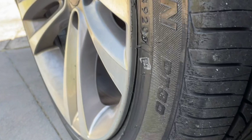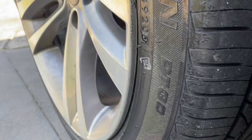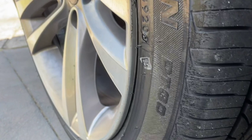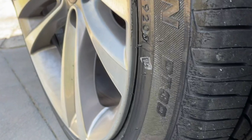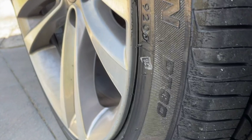Obviously I was very disappointed at these tyres. This was the day they were fitted — when I came and had a look at them, they were just so much smaller. The numbers on the tyres said exactly the same thing, but they were clearly smaller — less rubber on the road and less protection over the rim. I have really found Chinese tyres to be better at being true to the original size when you measure them up. I'll put a link about measuring tyres and what the numbers mean and how they're supposed to look.